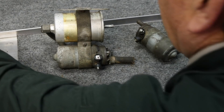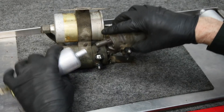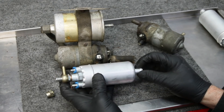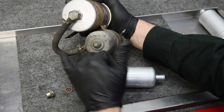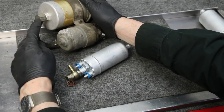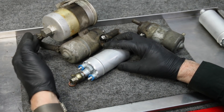Lo and behold, look what I found. This pump is from a different manufacturer but also used on the K-Jetronic fuel injection system. Look at the size of the hose coming from the fuel tank — no modification required. The pump is shorter, so it's going to be easier to adapt the hoses. This is the outlet hose to the filter; on this particular pump assembly the hose comes out of the old pump and goes right up into the inlet to the filter, and this is the outlet off to the engine. I can mount this, get the alignment right, install new fuel hose from the filter down to the pump, and get really good alignment without any stress or weird bends.